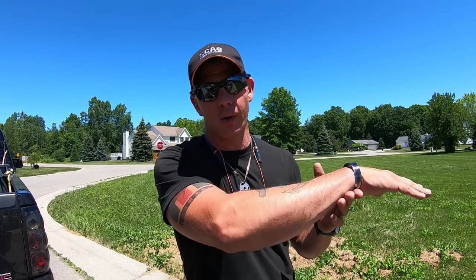I changed out all the basic little stuff just because I had spare parts, so I figured why not change them first. This has happened to me with a few different mowers over the years, and it's always either been air in the system, or the belt is slipping, or a pulley. I've tried all of them, and it's still there. It cruises right along fine, but when you take off, it grinds, and then as you're going, it's completely smooth. When you get to the end of the pass and you turn, it grinds. When you back up, it grinds. And then it smooths right out again. So, I don't know. Maybe you guys know.